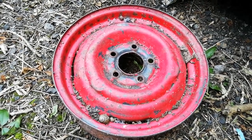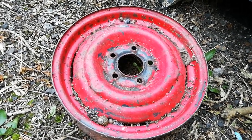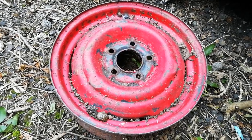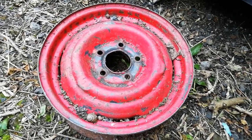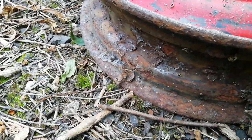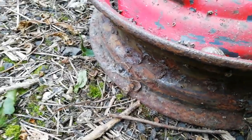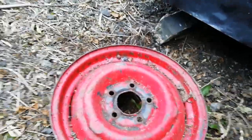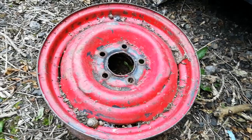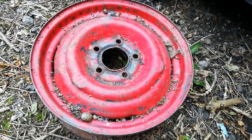I just happen to prefer the smaller stainless hubcaps on the later ones. Just seem to be easier to live with, and yeah, you can often get them in better nick. These came in 4 inch wide and 4.5 inch wide for estates and 1800 sports cars. Some of the early PVs will have even narrower ones. I did have some of those on a 444.